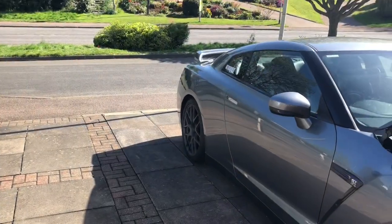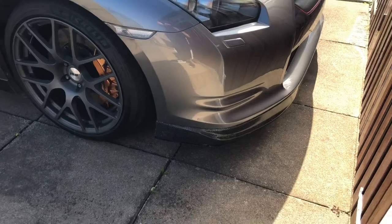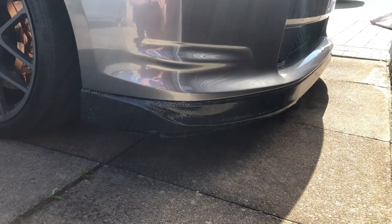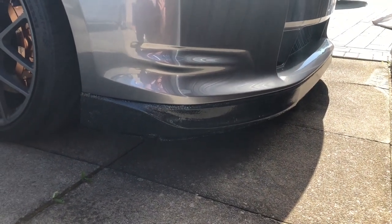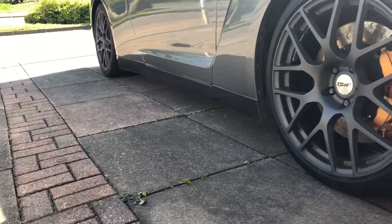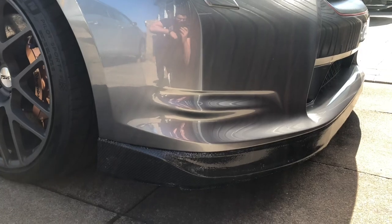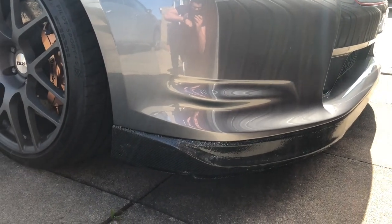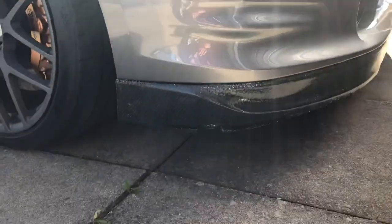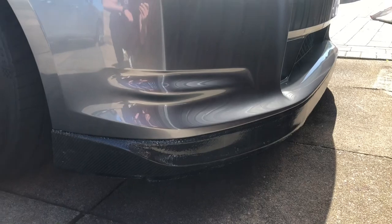So, a bit of an interesting point with this car, actually, is if you look down the front, down there, see a carbon fibre front lip. And yes, you can probably see some of the imperfections and some of the flaws, but I made that by hand. It took me about 3 days, I think. The original finished in that sort of grey wheel colour, and that side skirt, it was all the same colour. And this poor thing, bless it, was absolutely battered. I'm sure it had argued with every curbstone in Middlesbrough or wherever up north it was residing. It punched pretty much every curb, all trying to parallel park, I think, bless it. It was all damaged, it was all cracked, so I took some genuine carbon fibre cloth, some resin, some epoxy and some lacquer, and I set about making my own.